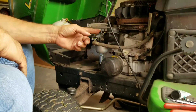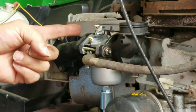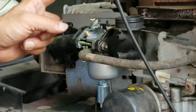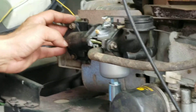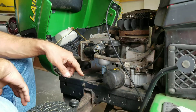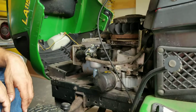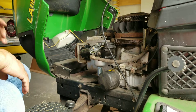I want to make sure it works. This is fresh out of the box, still dry, freshly installed. It did come with the gasket that goes in between the intake and the carburetor itself. It did not come with the rubber O-rings that go here or here. I did take this off too so I could just check it out and clean up the inside of the cylinder port a little bit. That gasket was good; this one was a little bit flattened out, but it should work. I put a little bit of O-ring seal on it — should be just fine. This is just for the air cleaner intake, so for now it should be okay to try to start it up.